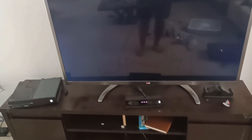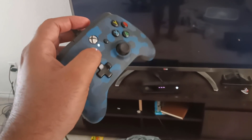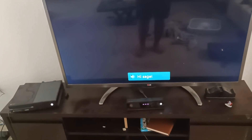So what went wrong? That's the kind of question I was asking myself for about two days when this was going on. I was literally trying everything to get it to work. My controller light was lighting on, so that's typically a good sign. I was messing around with the controller, pressing the buttons to see if anything would be receptive to it. The weird thing is that after the green splash screen, I was getting some signal to my television. If you long-press the Xbox controller button and the little menu prompt comes up, that's actually a good sign that it's not your controller and that your Xbox is probably fine from a hardware perspective. My Kinect was able to sense me even though I wasn't getting any response on the screen itself.